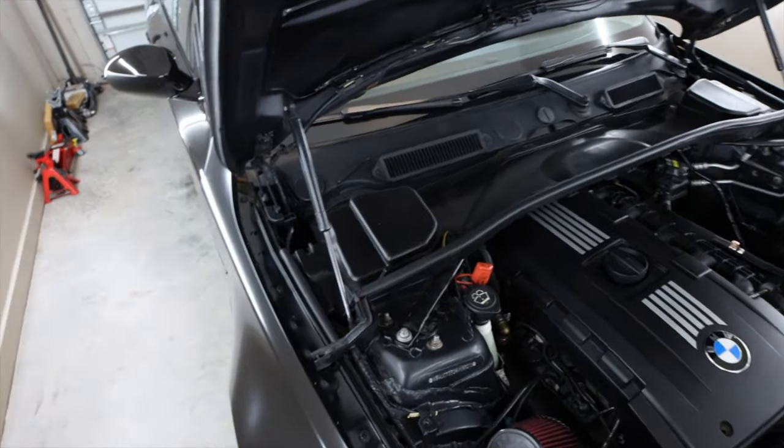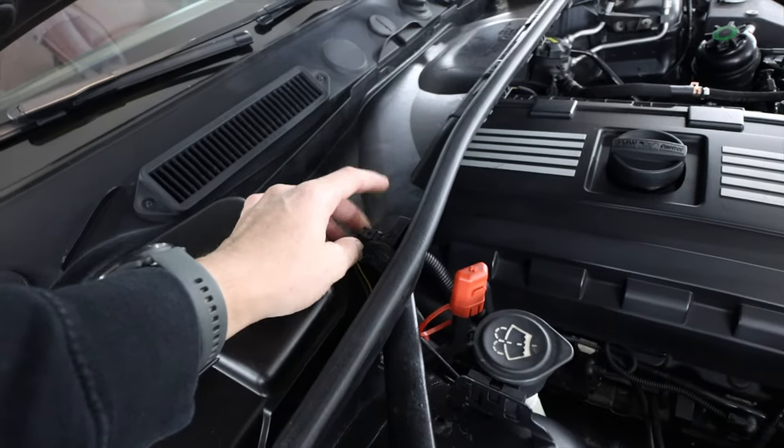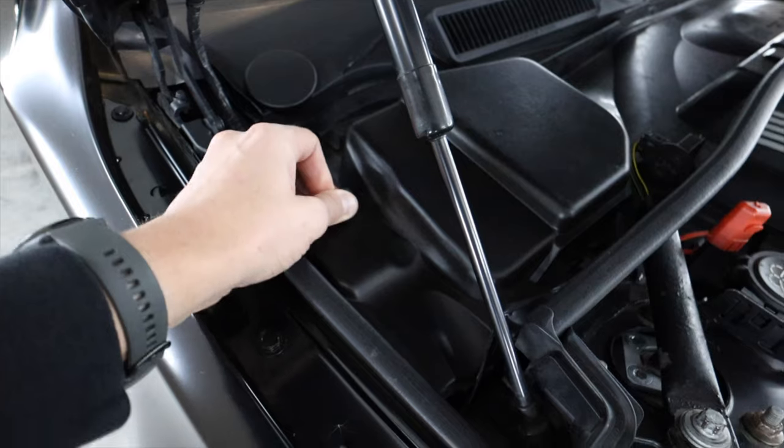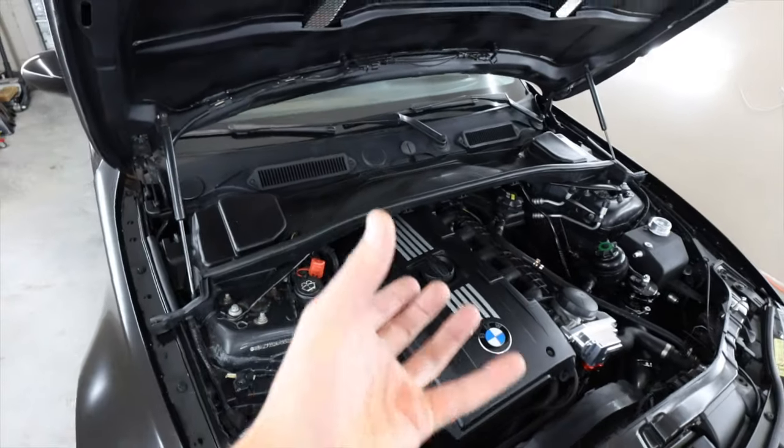If you wanted to do like the E9X cowl modification or a real OEM conversion, it's going to be a lot more expensive - I think it comes out to like $650 to $700 just to get all of the parts. In my opinion, just a little bit unnecessary to spend $700 just to change a cowl when you can do this DIY and it actually looks better. So first things first, we're going to go ahead and remove the entire cowl. It's pretty easy - you have these two plastic pieces right here, you have a plug right here that you need to undo. These just twist and you can flip this whole thing up. Same thing with that side and this entire cowl piece comes out.